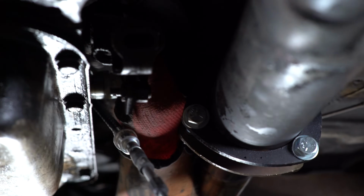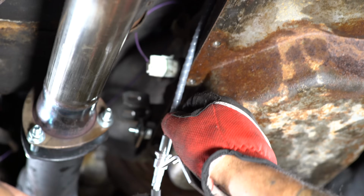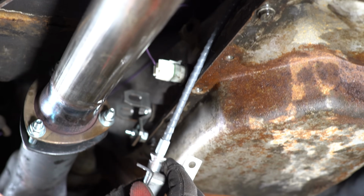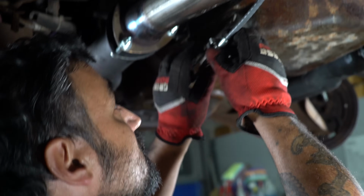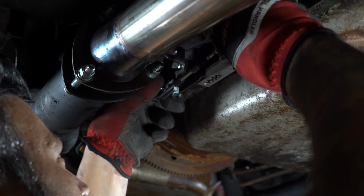This is the short selector shaft guy, so they send you everything you need if you had a long shaft style. The idea is that the measurement from here to the center of this pin is 5 3/4 inches, and then you should be pretty much dialed in. So that's what I'm talking about. Ultra tight. Cool. All right. That's cool.